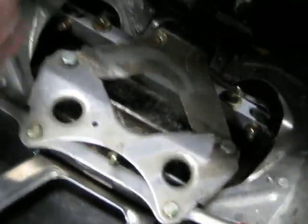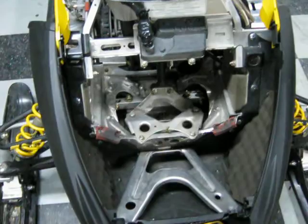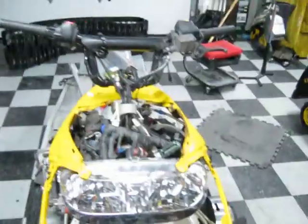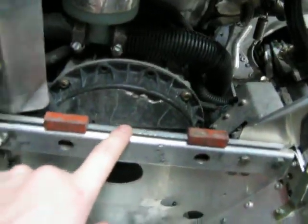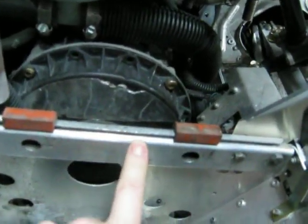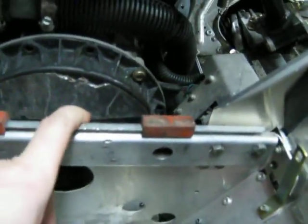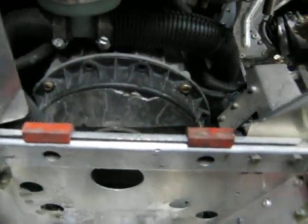It's all straight now, all in really good condition. The steering column had to have a few little parts replaced. The most part was good, because the handlebars were totally out of skew with the skis, so I straightened that all out. There was a kink right here — they have that thin piece of metal here. I pulled this brace off the 440, put a reverse hammer type dealio on it, pulled the bends out of it, and threw this brace on there. There are no bends in it at all now.